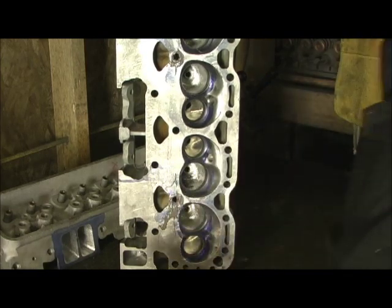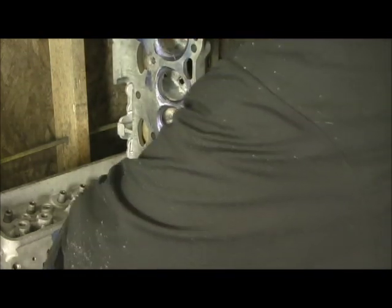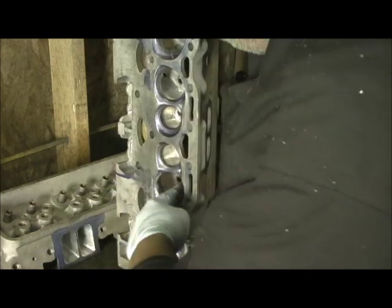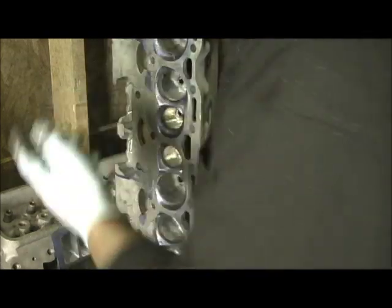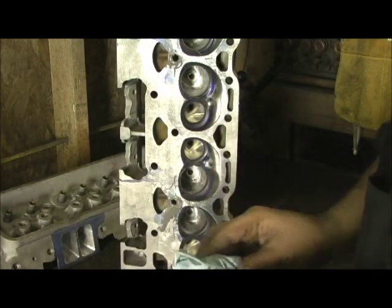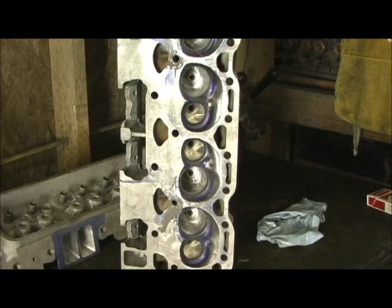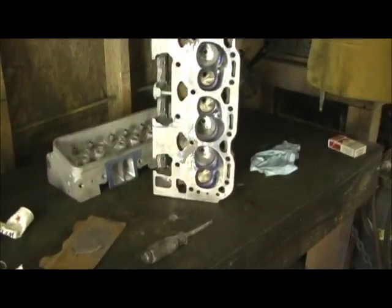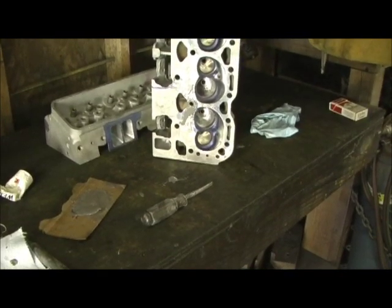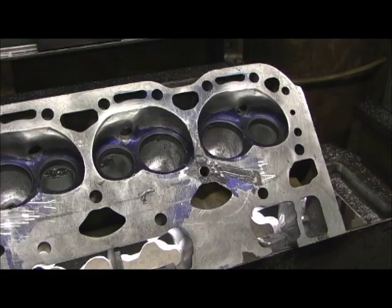What you just seen me do, besides make a mess, is put it in there and fill in the area of the tube. I've done it on both sides — I literally pack it in there. And now she wants to sit and wait. I've got to do the other head, but I think you get the point. Putting that epoxy in and doing all that makes a big difference. There's just no way it'll ever have a vacuum leak when you look at the fact it's got a press fit.